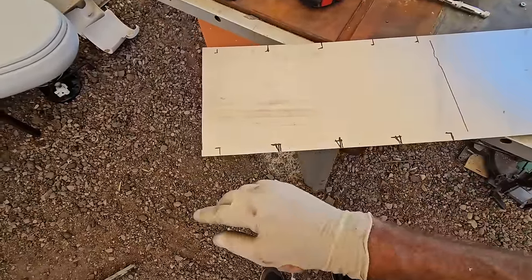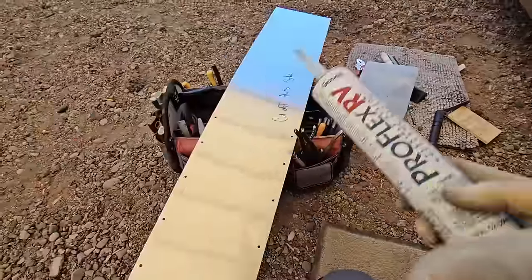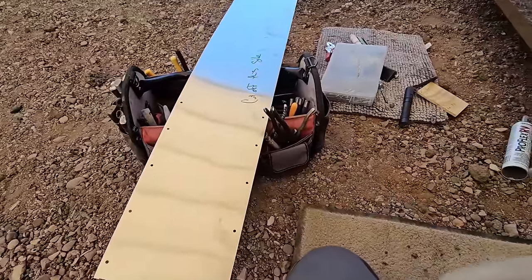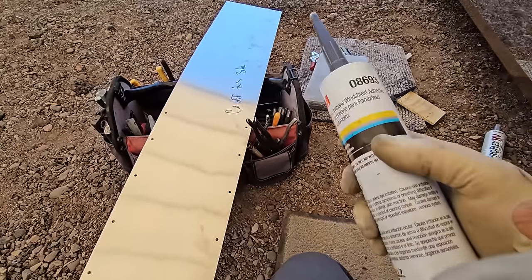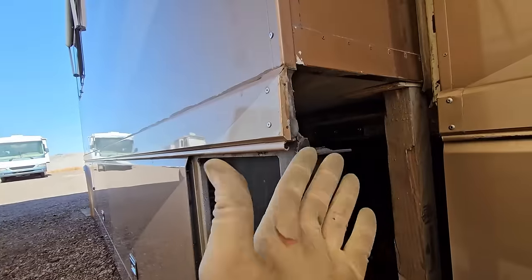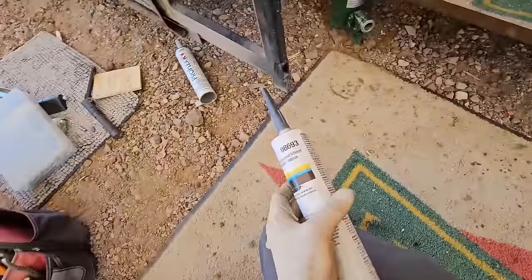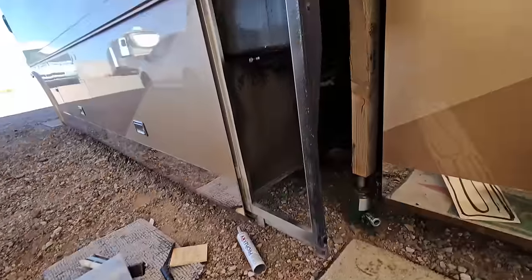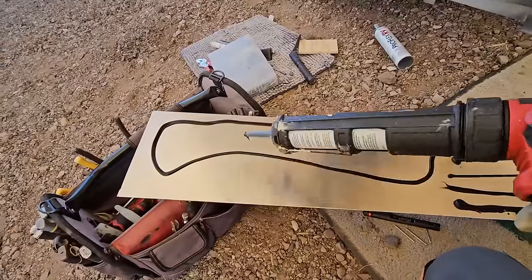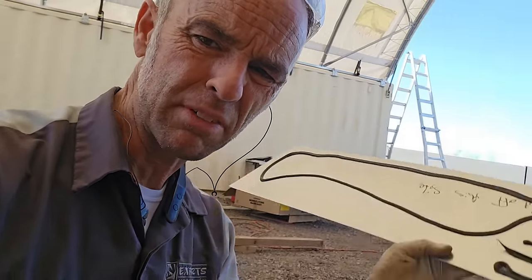Here are my rough measurements of where I'm going to put holes — might be a little too many, but I'd rather have too many at this point. In a previous video I just used some ProFlex to adhere this to the underside of a slide-out, but today I'm going to be using the 3M urethane. Do not use this if it's going to be going on top of carpet because this will ooze out and cause problems. Luckily it's going right onto tile flooring and shouldn't be touching the flooring at all. But if it was going to the living room where the carpet was, I would not be using this — it's a far superior adhesive though. It's going to be difficult to get in there without creating a big mess, so I have to be a little bit careful. Whenever you're working with urethane it will cover you somehow no matter what — it gets all over the place — so definitely wear some gloves.